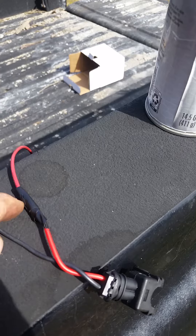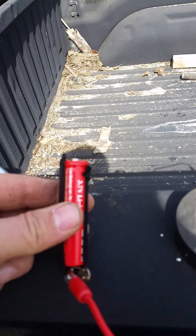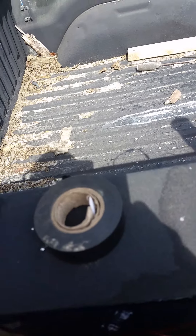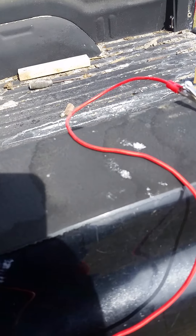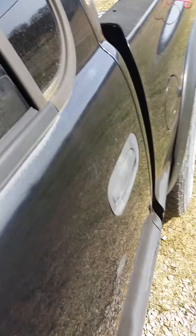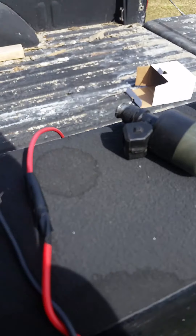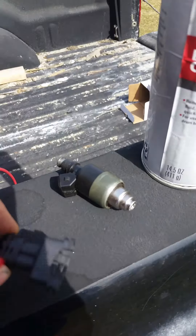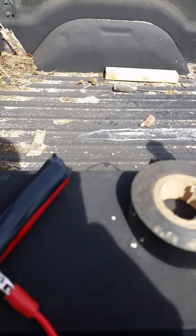This is a pigtail for an injector, wired up to two wires. Make sure no wires touch. I'm using a 3.7 volt battery. You could probably use a 1.5 volt triple-A or double-A — they probably all work. You don't necessarily have to have a nine volt. This 3.7 volt works. It's easier if you have a buddy — I don't have anyone out here.